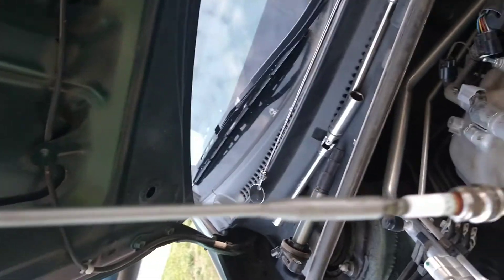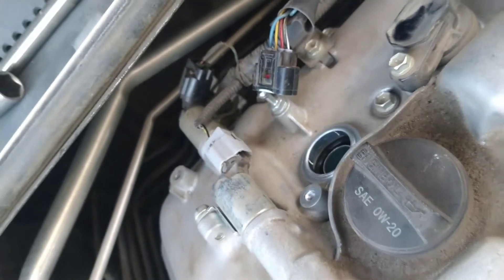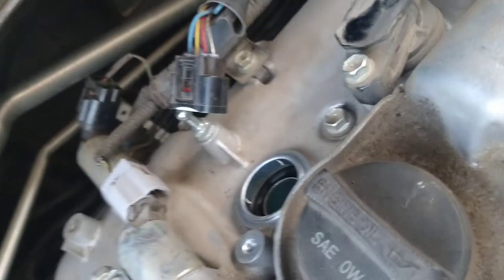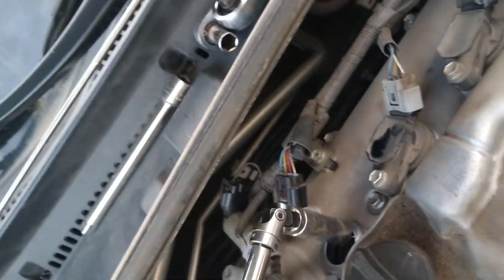Putting the plug back into the spark plug socket — I have one of these units where you press on it, it releases a little clip so you hook up the spark plug. I'm going to drop the spark plug gently in the hole and try to get a rotation in, maybe once or twice. The reason you don't want to just drop it by hand from the top is you're going to bend the electrodes where the spark takes place, and you might not have the right amount of gap. Once it's dropped in there, you have the universal joint. You may need to go around and pull this cover off in order to get to it.